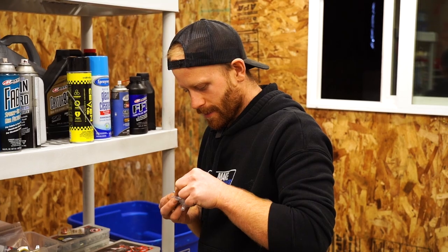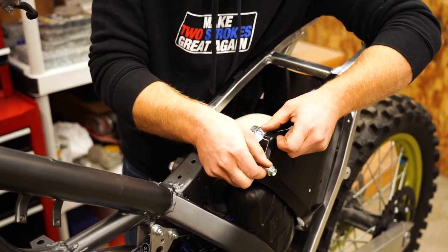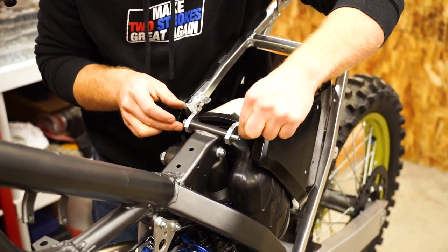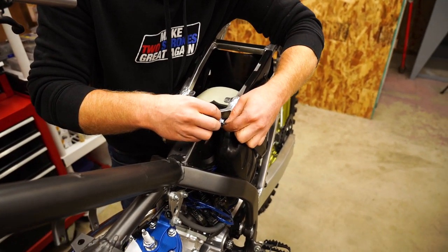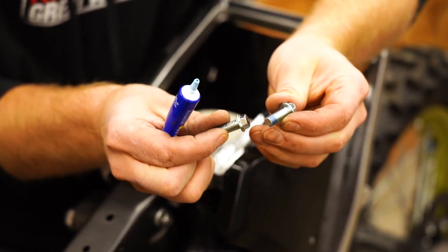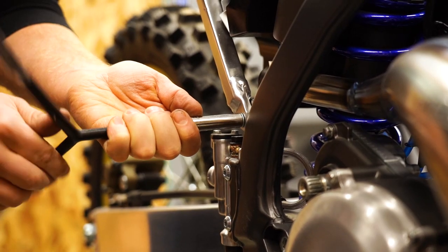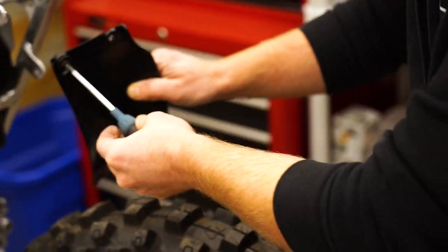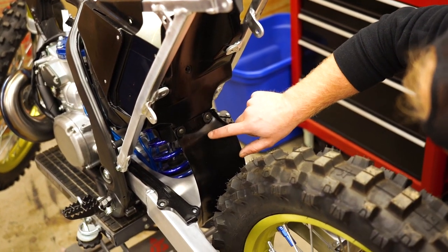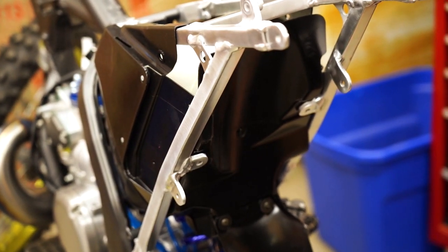Got my subframe bolt in backwards — I'm so picky when it comes to this stuff. I look at which way the engine bolts and motor mount bolts are going in. Let's go that way so it matches the motor mount bolts. Let's throw a little Loctite on here — the blue stuff. One thing I learned about Loctite: you want to put it just on the end, because as you thread the bolt in it's going to bring that Loctite all the way up through the threads anyway. Wow, look how close the finish of the new mudflap is to the airbox we just refinished — that looks really close. I'm really glad I screwed up this airbox and redid it. It's not worth cutting corners on all the prep work on this stuff.